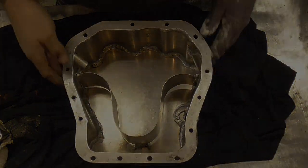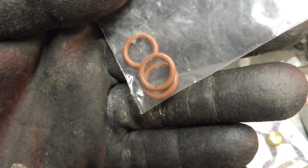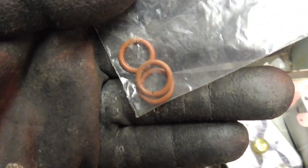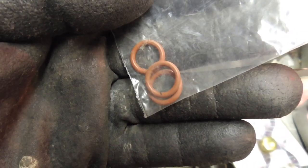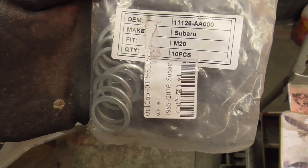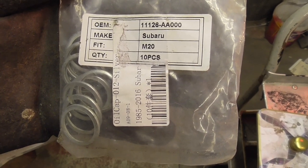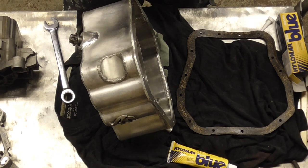When it comes to refitting your dipstick tube, order the proper silicone rubber seals from Subaru or an agent. These ones are a little bit more expensive than standard rubber ones, but the size is important — the small difference makes a lot of difference. They also seem stronger so they didn't break as easily, and I imagine they'll last a lot longer too. For the sake of it, get the right ones. I also ordered some crushable seals for the oil plug — that's the OEM number if it helps, fitting from a 1985 to a 2016 EJ20, though it probably fits a lot more.